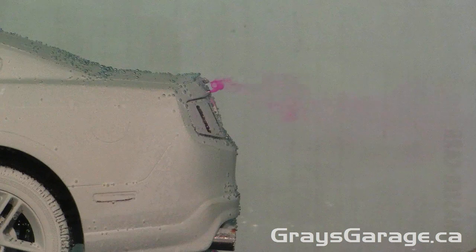If these recirculations are changing rapidly with time, you'll feel that as buffeting in the vehicle. The Ford designers did a really good job of fixing the separation lines, making nice hard edges at the back, and this helps stabilize the aerodynamics in the rear wake.